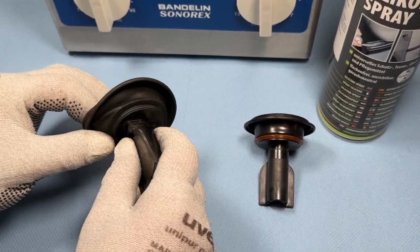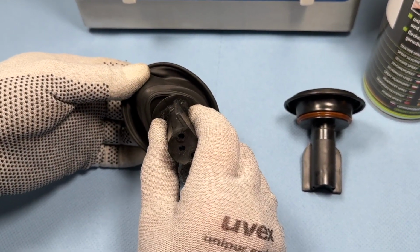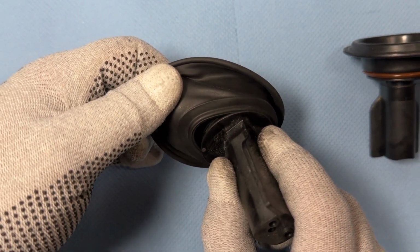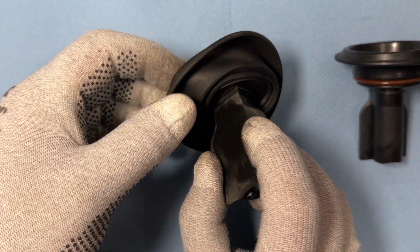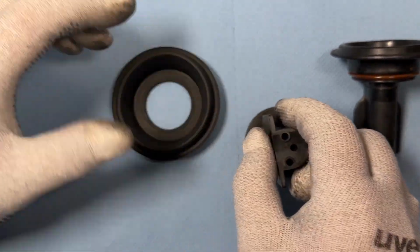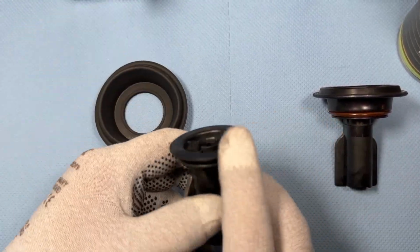Now let's focus on the diaphragm for your specific motorcycle. In your case, the diaphragm is seated in a groove on the slide. It's just placed in there and held by its own tension. If you pull it a bit, you'll see it quite clearly. Now you just pull it down over the plastic edge and then remove it from the slide. If you're replacing it anyway, you don't have to be too careful. And when you have a new one, it looks like this.